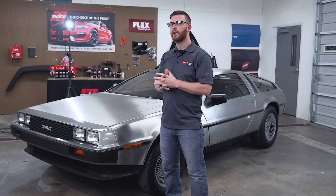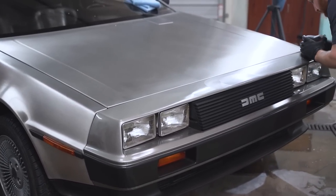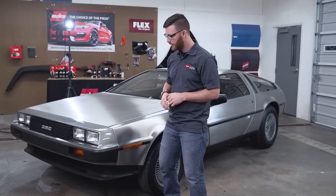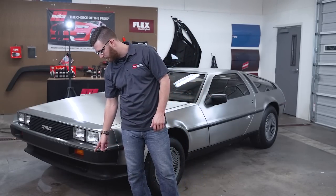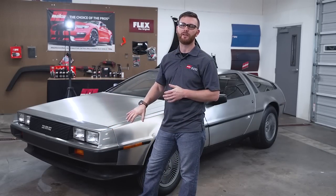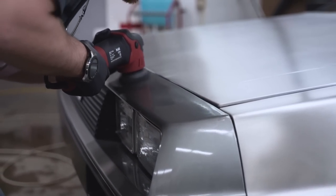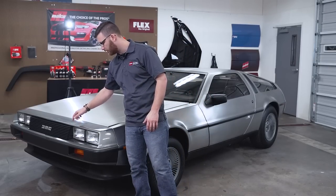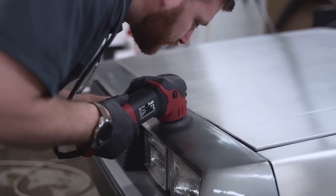These bumpers didn't really compound all that hot — they came out really well and we did a single step on them. I was hesitant to lay into them too heavy. There are still some scratches on top. You can see it is a rubber bumper that has been painted, and I think this is a factory tape line down here. I always worry about adhesion on bumpers like this, especially something this old. I really didn't want to get a lot of heat into it — just a light, quick correction. It's been hit by something and has some pretty good scrapes there, so that was really the only area I focused on.